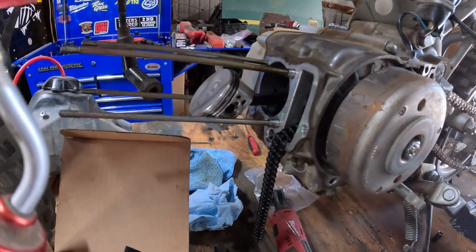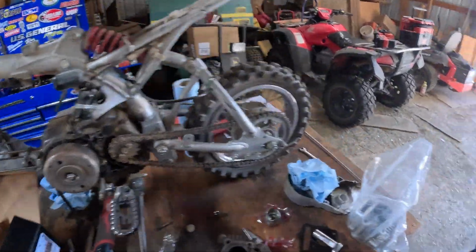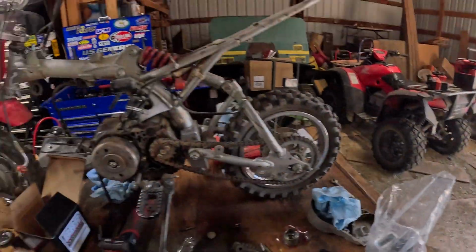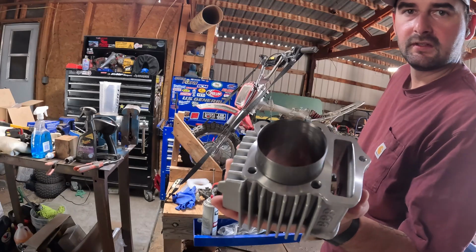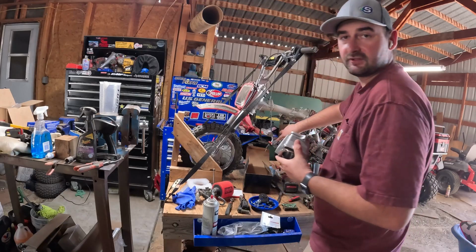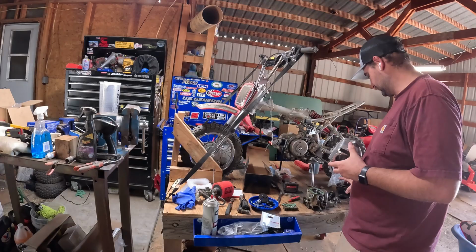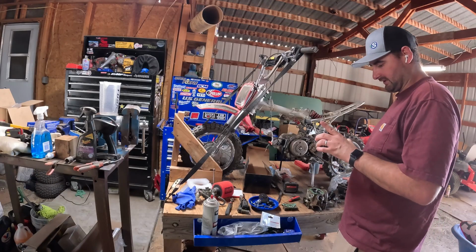All right, I went ahead and installed the piston. Those circlips are not fun. Let's go ahead and put the cylinder on there now. Nice cross hatches in the cylinder. So we already got two dowels in the bottom of the case. We'll take the other dowels out of this old block, our old head, put them in the top.